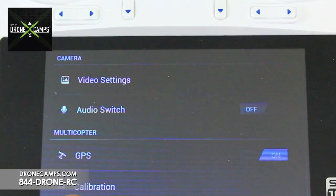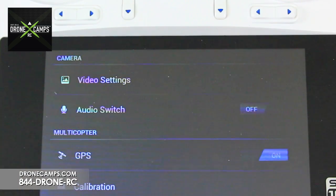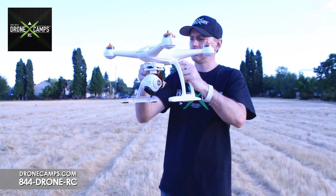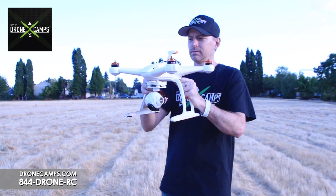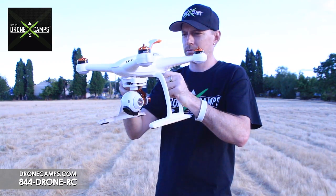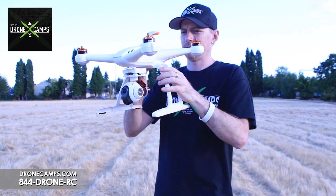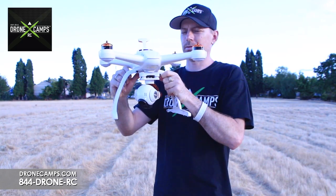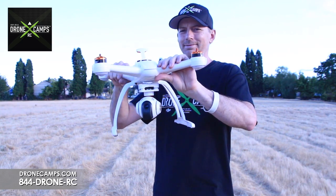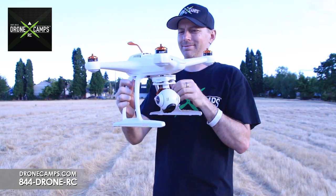Once you've clicked on compass inside your ST10, go ahead and pick up the drone. You'll notice that the drone starts to flash yellow lights on the bottom. Go ahead and point it at True North — the two front LEDs will start to flash yellow. When they do that, they're ready to begin the rotation in the forward direction. Once you get back to level, the next LED light over — face that north and begin the rotation as well. When it comes back to level, the next one in line will want to be pointed True North.